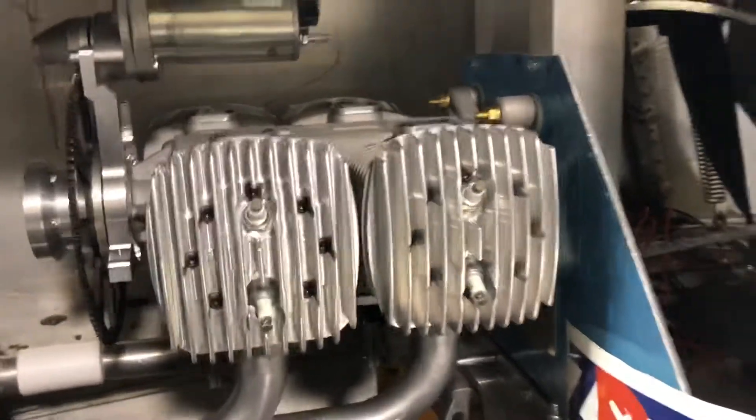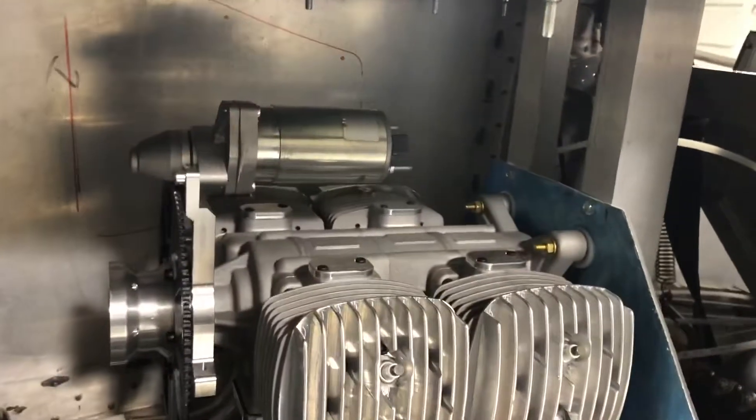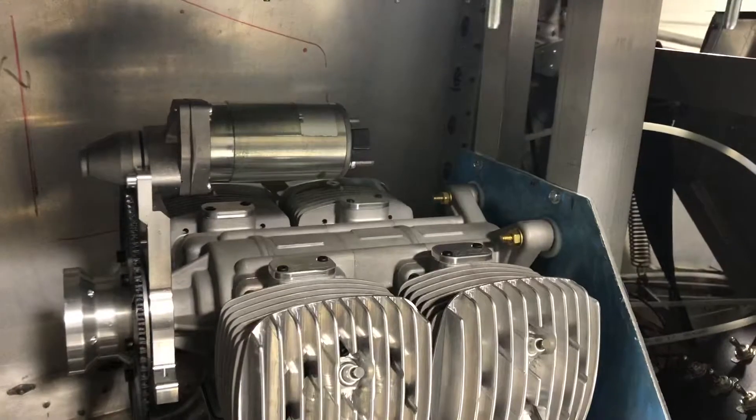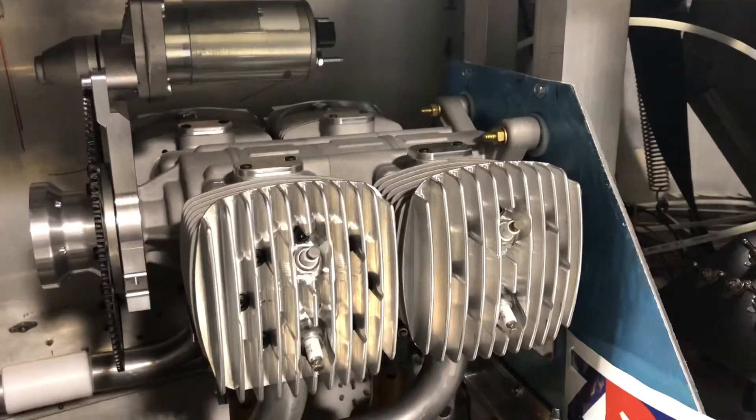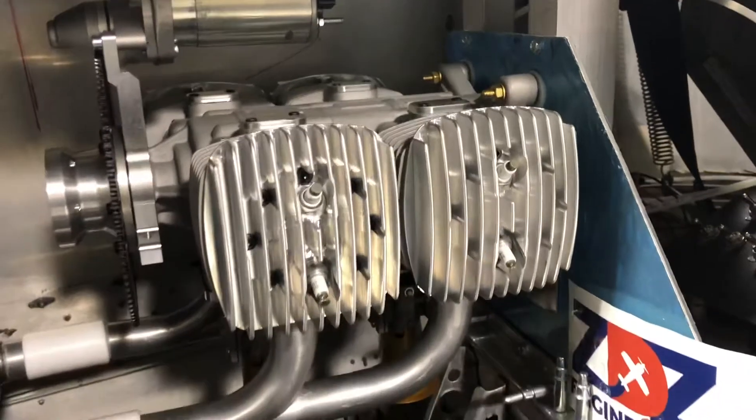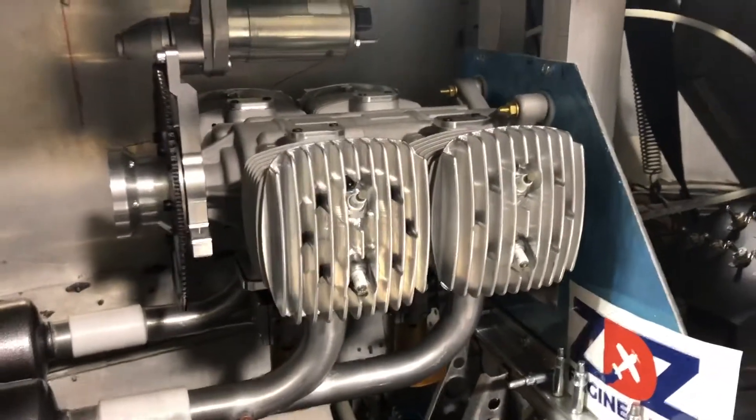The heads do rotate, giving me vertical cooling fins, which allows the cooling box to be built on top — driving air from the intakes down into the box and directing it over the cylinders and heads. This should work out just fine. I'm quite delighted. Now I'm headed back to my office to get to work. BD-5 pilot out for now.